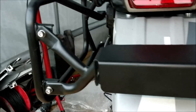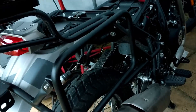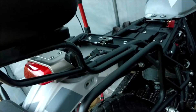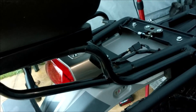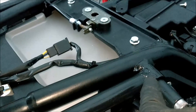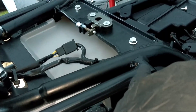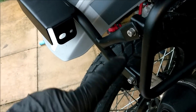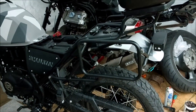Right, final part — it's all bolted up now. Just a word of warning: if you ask the guys at the dealership to fit the panniers and you've got the standard rack on there, when you go to change your rack you're going to be in trouble unless you buy the same one. I bought this one off eBay. You will have to drill out inside there with a 13mm drill bit because it's got about a 10mm sleeve inside — it should be 5mm — so the bracket slides further in and brings the two edges together to fit properly.